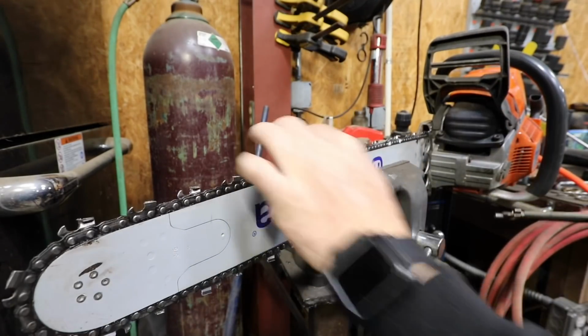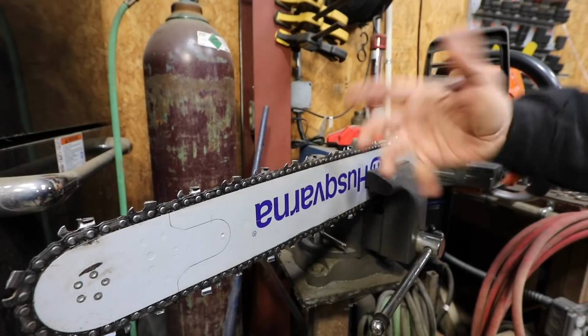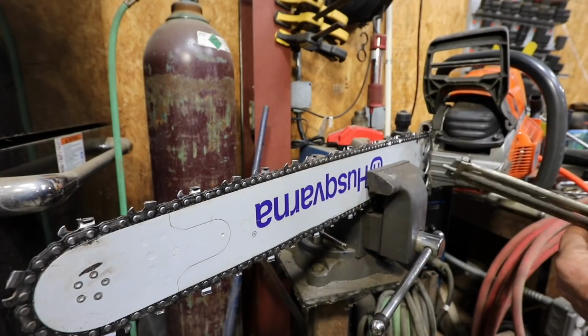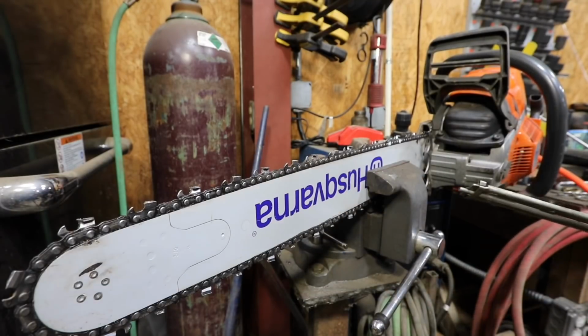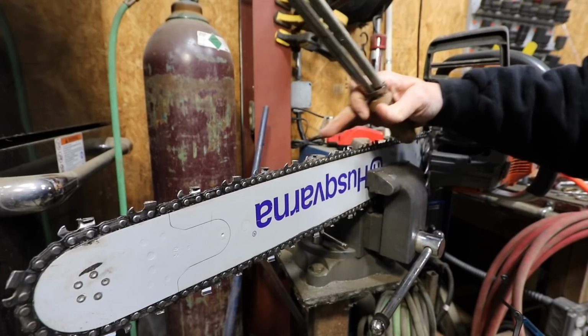The chainsaw bar is upside down right now, so it'll wear every few tanks of gas. I flip it back and forth so that it'll get even wear on the rails. I like to file them.